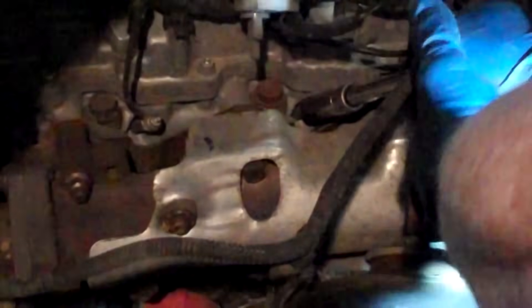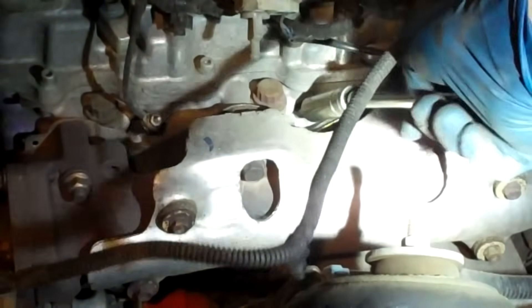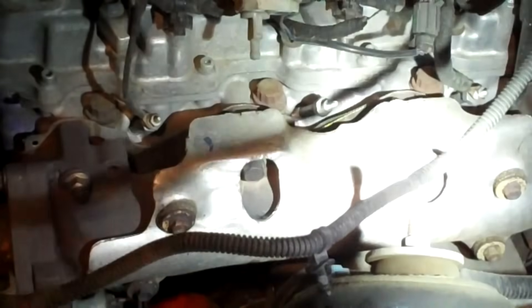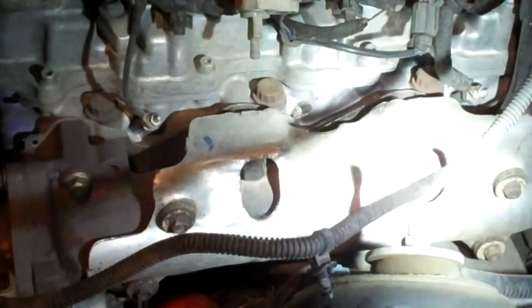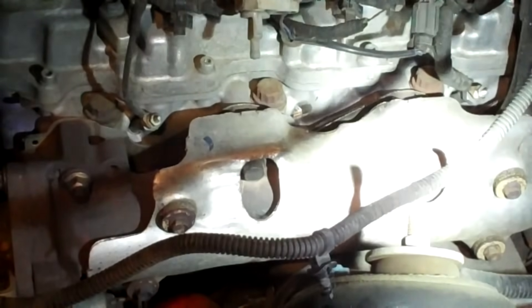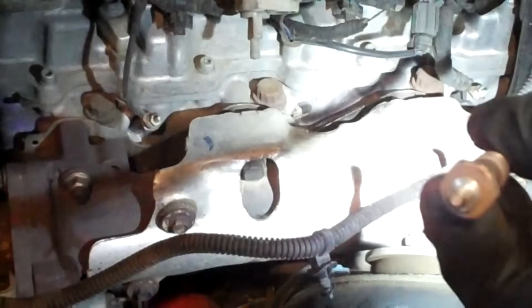They usually crack really hard when you first get them, and then they come out pretty easy. There's the crack — ditch the ratchet. The threads are kind of long. It's a 12mm deep socket — I often say the size but sometimes forget to mention it. This is an Isuzu motor with a Bosch glow plug, so of course it's metric. If it were a BMW product it'd be 13mm, but Isuzu and a lot of Japanese manufacturers like to use even numbers, so it's 12mm.